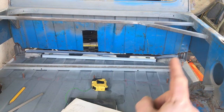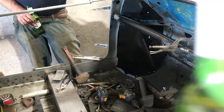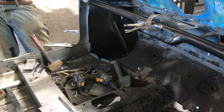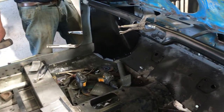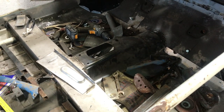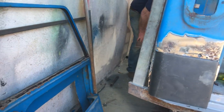We've pulled the two side posts in - across that side 50 inches, looking nice. We need to stretch this floor along that white bit but it's quite high in the middle. The inner wing to the sill board looks good though, so that's a good sign. The subframe holes are very equal as well compared to where the little notches are, which are never quite right anyway - I think they're manufacturing tolerances or they copied them.